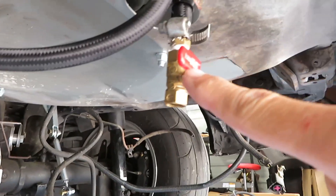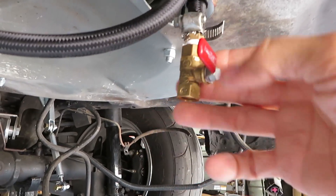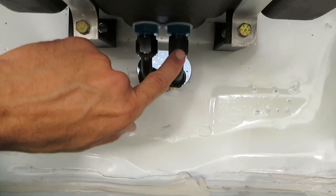I also ran a drain — basically just a drain because I have two separate outlets on the fuel cell, so I'm using one of them so I can drain it. When you're running E85, it's a good idea — especially if it's a race car that sits a few weeks between track days — to drain the E85 out, put some 93 octane in, and run it for a few minutes to get your injectors lubricated, because 93 octane has lubrication in it and E85 does not. It's very corrosive.